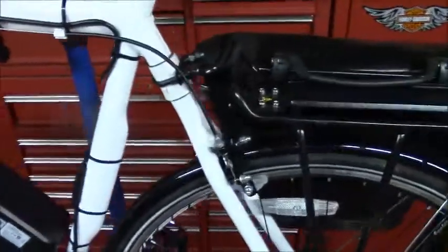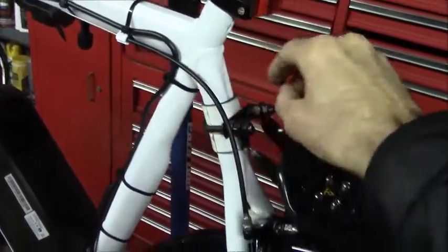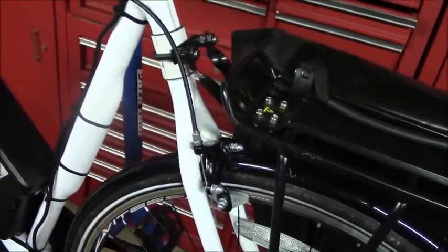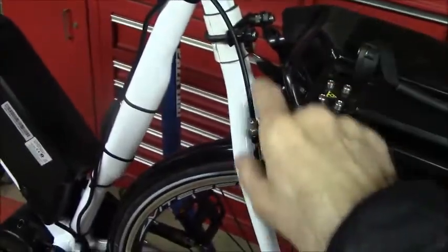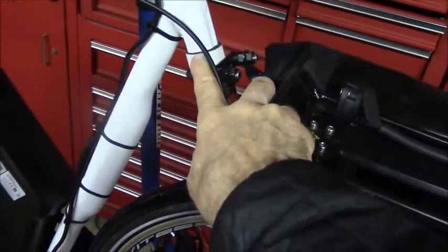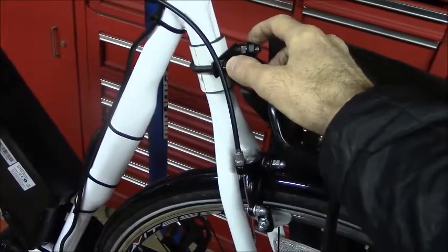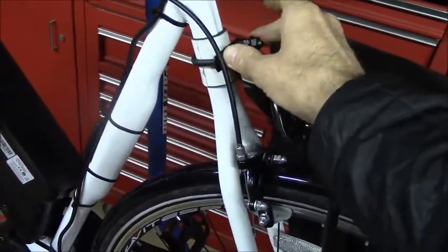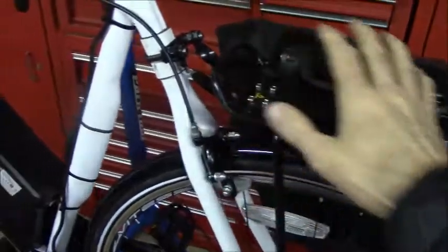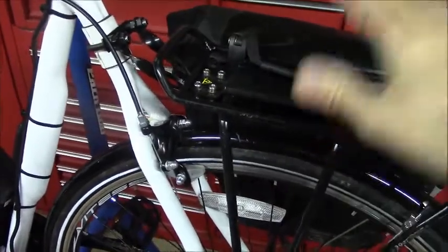The rear rack. Normally on a bicycle you have two seat stays in the frame that run from the dropout to this part of the frame. This one merges into this one piece here, and they really don't give you an easy way to install a rack. So what I did is I got some Gorilla tape, put it on some inner tube, and then cut the inner tube to match the dimensions of the tape and wrapped it around the frame here. Then I went to Home Depot and got a pipe clamp. I don't remember the size of this. I think it's 1.25 inches, 1.5 inches. I clamped that onto the frame and attached the rack to that clamp, which works really well. I'm really happy with it. I don't think I'll have any problems with it coming loose in the future.